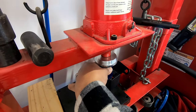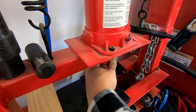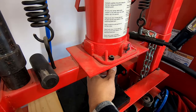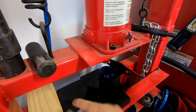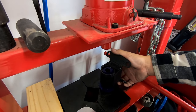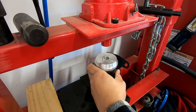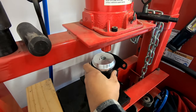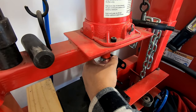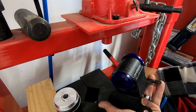Now that the two main sections are all welded up, it's time to press the bushing into the trans side of the mount. I went ahead and painted the mount in wrinkled black before the bush went in, just so that I didn't have to mask anything up when I came to paint it again later. Set the mount up square in the press and don't forget to lube up the outer edge to aid the bush going in initially. If you don't have a press, you can do this in a vise. Short of that, you can rig up a long bolt with some big washers to pull the bush into the mount.